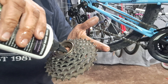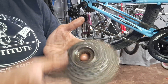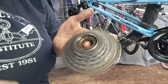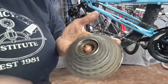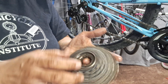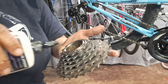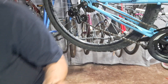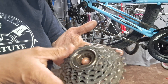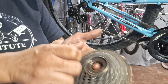Whenever the oil starts to disappear and flows through, just add a little bit more and spin it. Right there I could hear a difference in sound - it just suddenly went really quiet and now it feels smooth. I can feel the oil coming out on my hand on this side. You could hear and feel once the oil fully penetrated. Listen to how it's like a ghost freewheel now - it's much quieter and moving really smoothly in my hand. Give it a lot of spins to make sure the oil is moved around everywhere, lubricating all those parts in there.